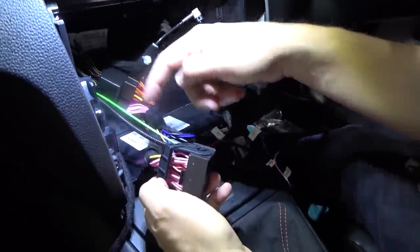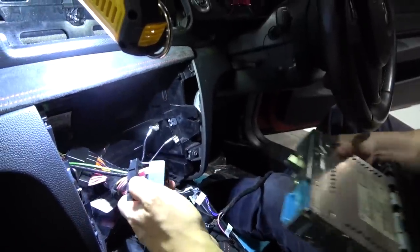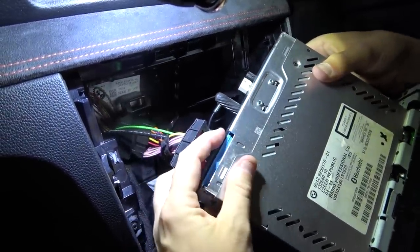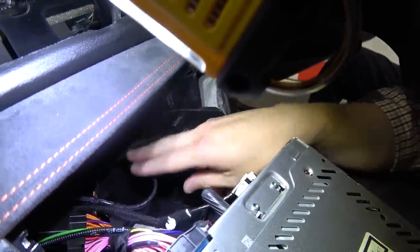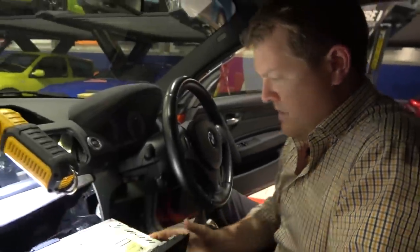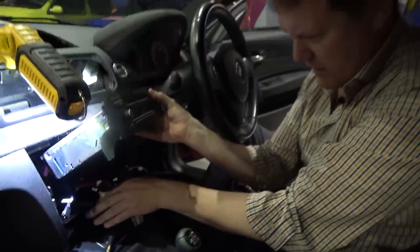A little bit of fiddling around later — we've got this extra wiring loom in place. These are the optical cables for the sound, which have been moved ever so slightly. We've got everything in theory just released a little by cutting some of the soft tape that's been in here. But I think we should now be able to connect these three parts back on. We've got this clamp on the back — open that up as much as possible to get this in and get a secure and good fit. Make sure that's in and lock it down. And then underneath it we've got our wiring loom that we're going to be wiring through, plus the additional leads that go into the climate control panel.